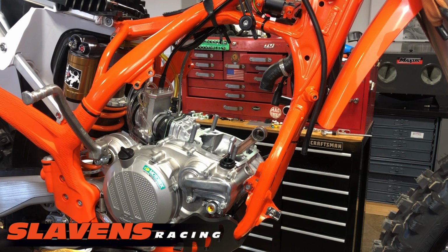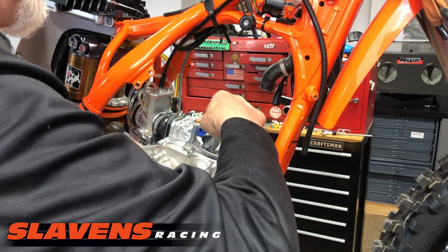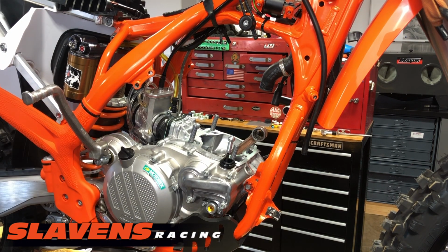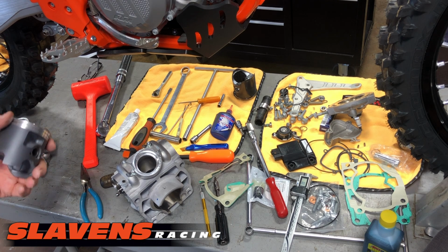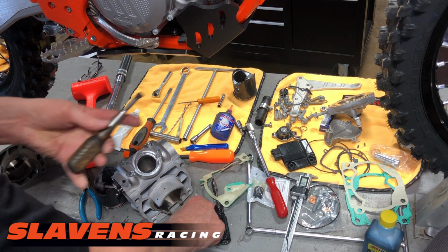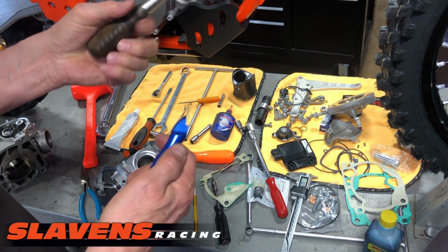All right, from there we're going to go over here to the gasket tools. Scrape this. I don't think you guys need to watch me do that, so I'm going to stop the video for a minute. Okay guys, now I've got the gasket surface all cleaned. I used a combination of scrapers. I used the X-Acto knife, and I used this scraper, which I like the best. This is a really old one from Mac Tools from about 30 years ago.